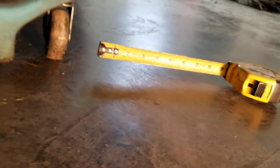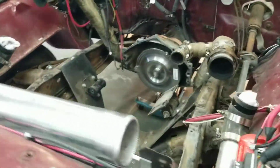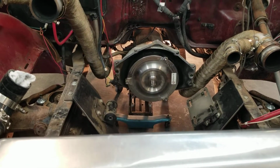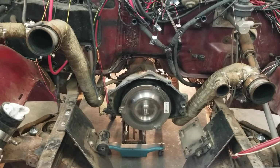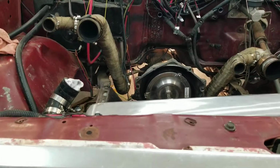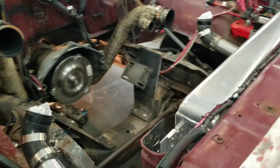All I did was put the engine and transmission together, dropped it in the bay with the engine hoist and a transmission jack under the pan, got everything lined up like I wanted it, and then just started marking pieces. So you section your transmission cross member, you make your new mount, you bolt the center section of the transmission cross member to the transmission, put your sectioned frame sides of the cross member in, and get the transmission where you want it situated. Get your little 4 inch by 10 inch 1/4 inch pieces in there. Get them all marked or even tacked in place. Then after you get your motor mount set up, you can pull that back out and fully weld it. Hopefully this makes sense. If I figured it out, y'all can.